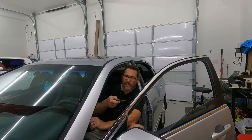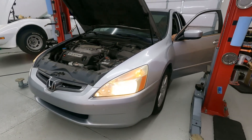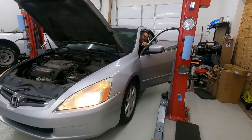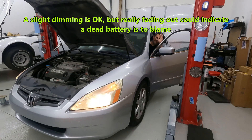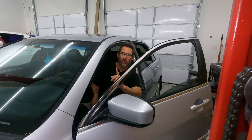First, you turn on your headlights — go look at the headlights there. And then you take your key and put it in the ignition and try to turn it over. What we want to look at is: do the headlights dim while I'm trying to turn it over? I'm turning it over right now — are those headlights dimming? No. So that tells you right there that your battery is probably not the problem.